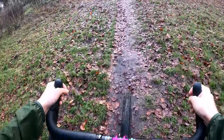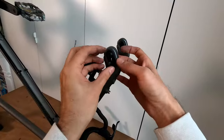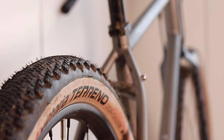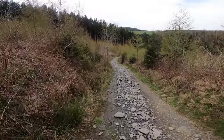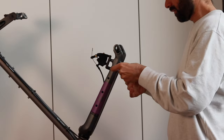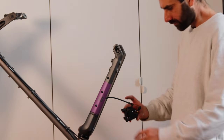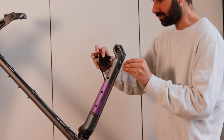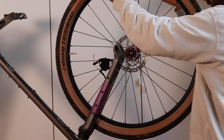I also like the versatility: with the aggressive geometry setup and fast gravel tires, this bike can be a super fun and performing gravel bike. Then by flipping the chip on the fork and putting on bigger tires, the bike is ready for long trips on gravel roads, forest roads, and double tracks. Flipping the chip takes about half an hour — it's relatively easy but you do have to change the brake caliper adapter, meaning every time there will be some adjustments. I personally would change it only once or twice per year.